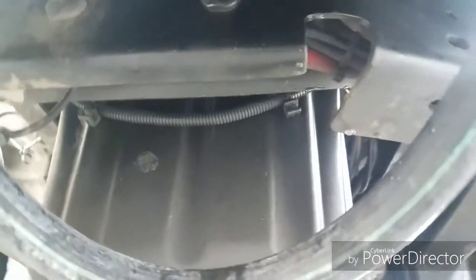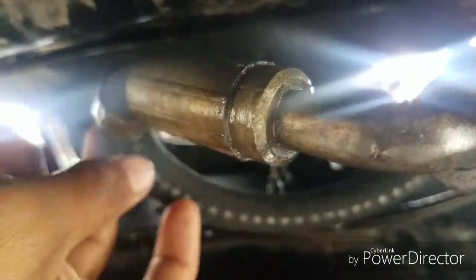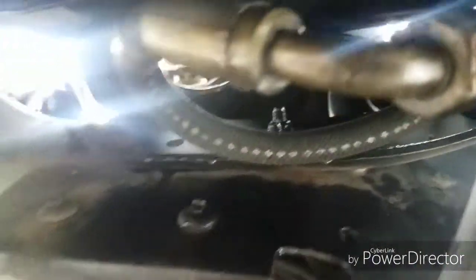With the DD15, let me show you what happened — the oil from the transmission was getting into the cooler. This is just so you know, so you can run to the shop. Don't keep it like this. There are two lines: this one comes from the transmission and gets into here, and then the other one — the oil comes out here. So what I did was I connected the two hoses.